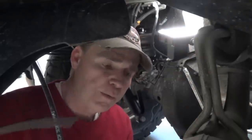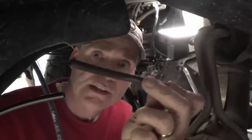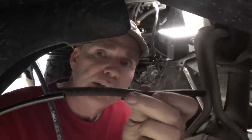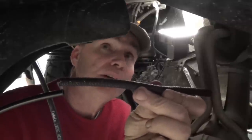I'm going to run this air hose down to the passenger side airbag, but there's all that exhaust that runs really close to the air bag. So Air Lift gives you this little piece of heat protector tape, which is very similar to the tape that Ford provides to protect the electrical line that comes along the back. You definitely want to use it in the closest place it gets to that hot exhaust pipe.